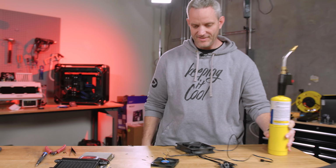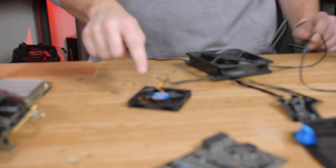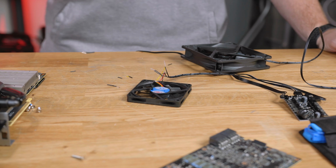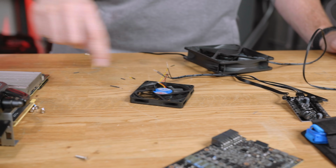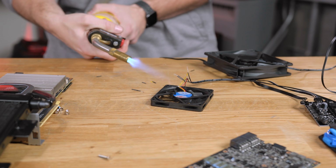Yep. Yeah, hey, I called it. Good job, Phil. Phil figured it out. This is a heat sensing plug right there. And so he was like, well, wait a minute. If that was stuck down in there, maybe that's designed to only turn on when it reaches a certain temp. So we decided to just wire it back up and hit it with heat.